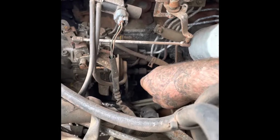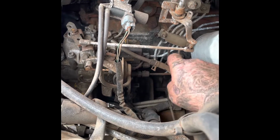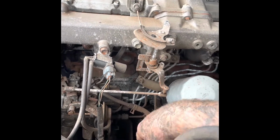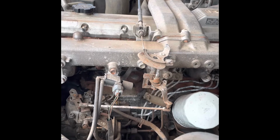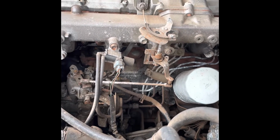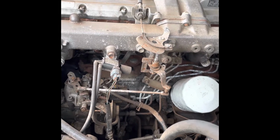Well, they say everything happens for a reason, and I live by it. Everything does happen for a reason. So we had the fuel leak. The rail that lives underneath that one was leaking. See all the rails that come in and feed all the injectors up the top? The bottom one was leaking, so we sorted that. So that happened, and I had to get underneath to see it, and I found that bolt that had the nut missing that supports all the front diff. So that happened for me to find the nut down the bottom.